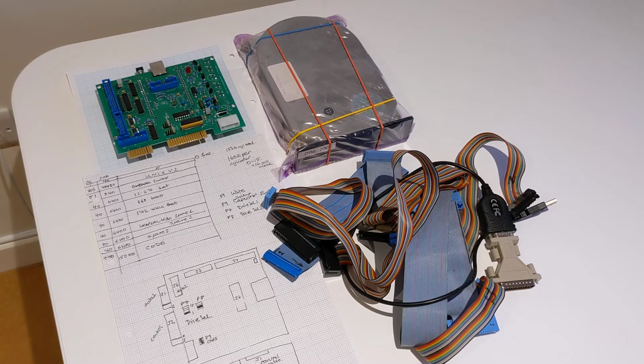So the device on the left is the David Gesswein MFM hard disk emulator. When I say MFM, I mean the Seagate ST506 interface. Now this is a disk interface that was first used in large numbers by the IBM PC, so that's 1981, but I used it in computers before that date, so in the late 70s. So Seagate came up with this original hard drive interface, and it was used very successfully on pre-IBM PC generation computers, of which I'm still a great fan and owner.